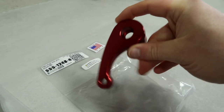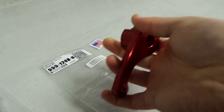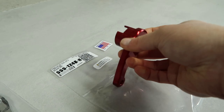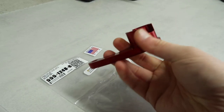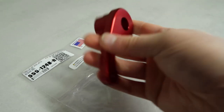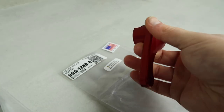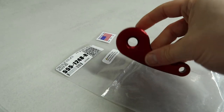It's a slightly different shape — you can see that curvature there. Steeda described this added curvature as a more ergonomic design, since the stock piece is just straight plastic. This will make actuation just a little bit easier. Replacing the plastic part with this much more sturdy aluminium piece has the benefit of lasting longer. There has been talk of the Ford plastic releases weakening and loosening over time, even breaking, so this removes that possibility.